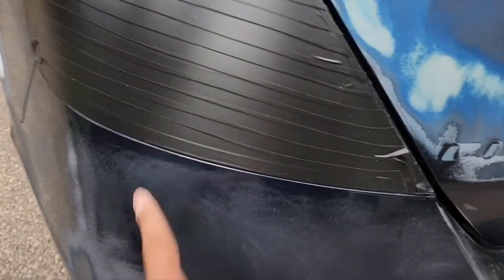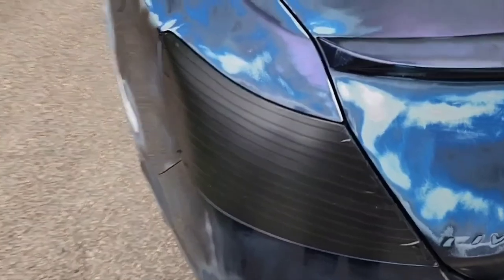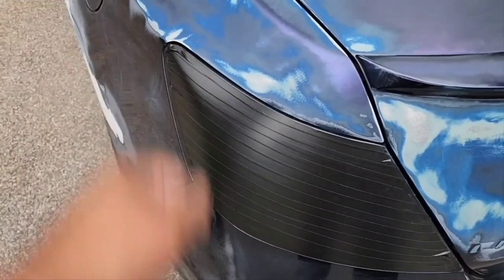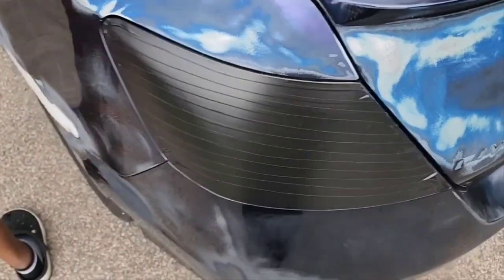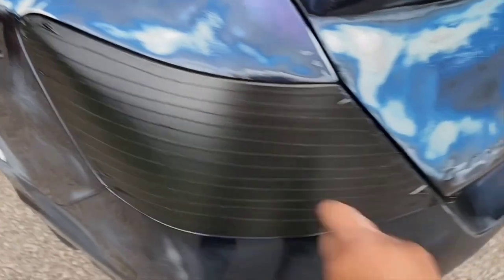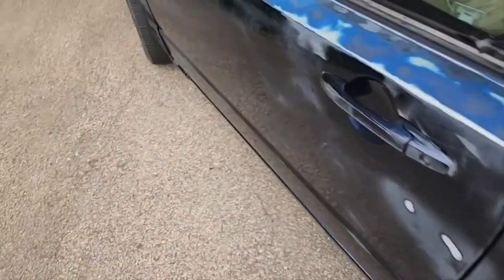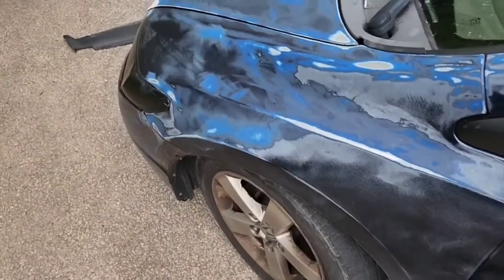Dark Knight. Oh, okay. So the bracket here is right underneath the bumper, and I feel like that's gonna be time consuming to take out. Therefore, I just mask it with the tape. Now, the reason why I use electrical tape is that once I'm done with this project, I can easily just peel it all in one take, and it will be nice and clean instead of the blue masking tape, which is gonna leave residues, and I'm not in the mood to clean a headlight or taillight.